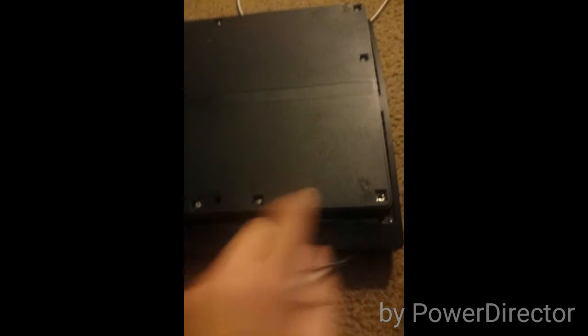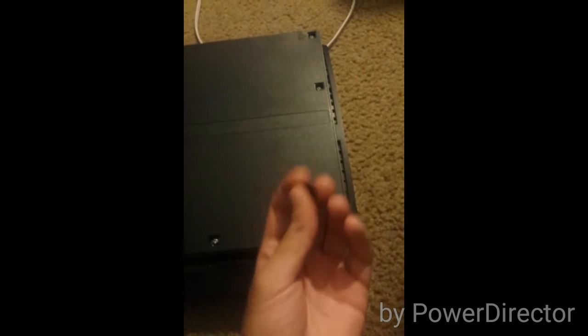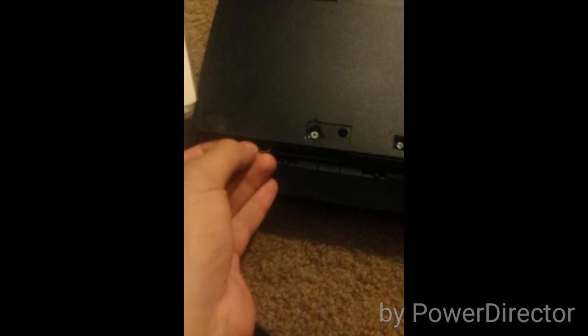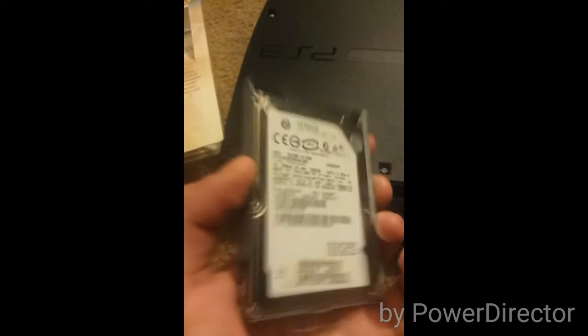First, all you're going to do is take all these pieces out. You can pause the video and do that. Go to the hard drive — sometimes there'll be a screwdriver cap here, rubbery or just like this, and you pop it up. There's a screw holding the hard drive down. Just pull out the hard drive, because in case you drop the system, your hard drive and personal information won't be damaged. Put that to the side.